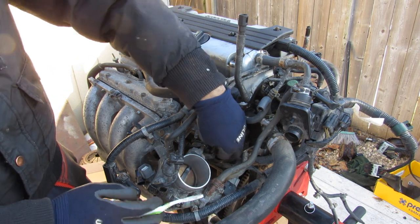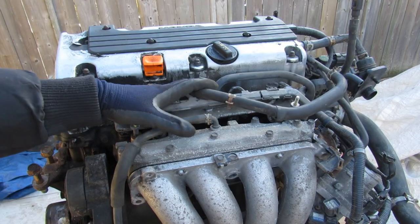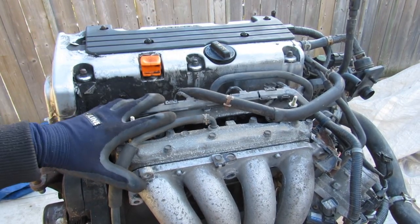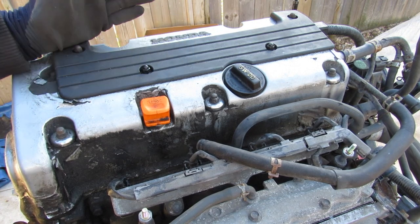Now this is a drive-by cable setup because it's an older engine. That'll feed air into this cast aluminum intake here that'll push it into the engine. At the top of the intake we have the fuel rail and its fuel injectors because this engine is port injected only. At the top of the engine, underneath this plastic cover, is where the four coil packs and spark plugs will reside.